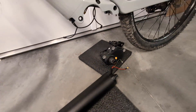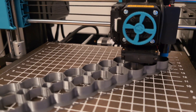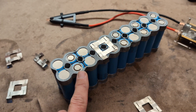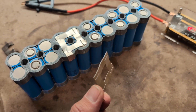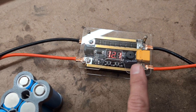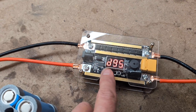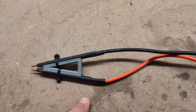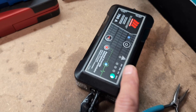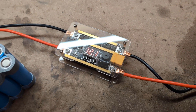You have to take out the motor on this bike to get access, but let's get going. The first thing I did was design and 3D print battery holders to keep the cells aligned and perfectly spaced to fit in the case. I cut up nickel strips in grid patterns and I'm about to spot weld them onto the battery. I'm using an inexpensive spot welder from AliExpress — links below, it's under 20 bucks. You can set different power levels and add a delay. I 3D printed a little bracket to keep the probe tips exactly spaced, and I'm powering it with a portable jump pack for boosting cars. You can also use a car battery or a spot welder with its own power source.